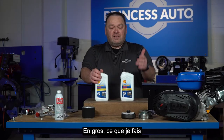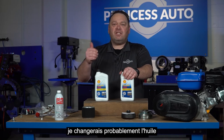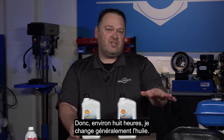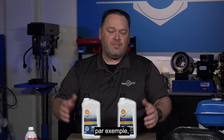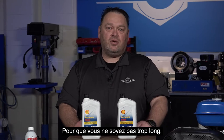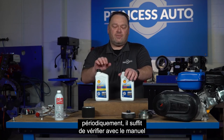What I do with my equipment is, after about eight hours, if I bought this engine and put it on a go-kart, I would probably change the oil. Because of the wear and tear, just the break-in period of that engine, you may start to get a little more material from the build and you want to get rid of that. Then depending on the seasonal product — snowblower, lawnmower, or something I use all year like a generator — I'll change it about every 200 hours or so. But that's just something I've put on a schedule; check your manufacturer's recommendations so you don't go too long. It's no different than doing oil changes on your vehicle.